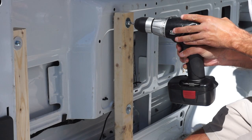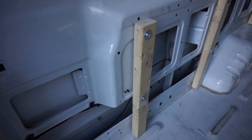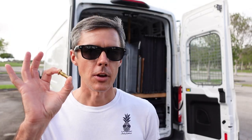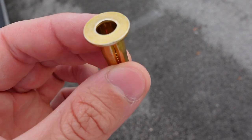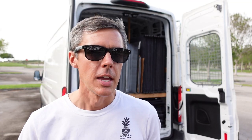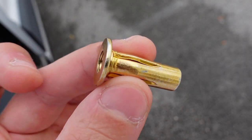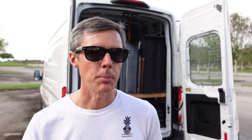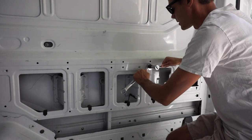First, I installed vertical pieces of 2.5x1.5 wood at intervals along the side of the interior of the van. And the key to doing this are these rivets. These rivets pop into pre-punched holes that are along the interior of your van already, and then they create a thread hole that you can then screw a bolt into. I'm going to put a link to these in the description of the video, and I'll link the proper size for a Ford Transit, so check the diameter of the holes in your van if you have a different model. The rivets pop into the hole, and then you use a tool that's provided with them to fasten them into place, and now you have a threaded hole that you can then screw a bolt into.